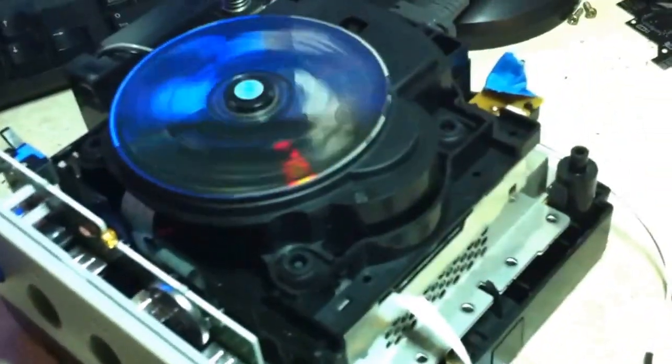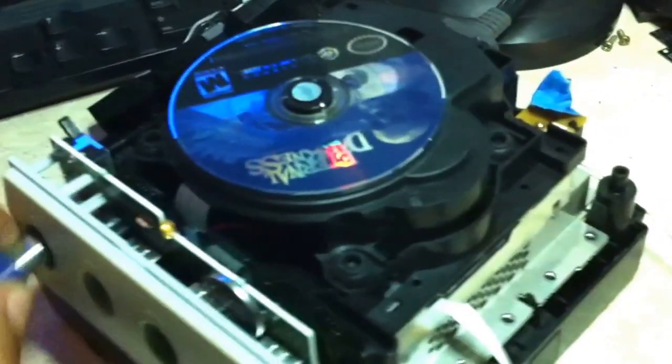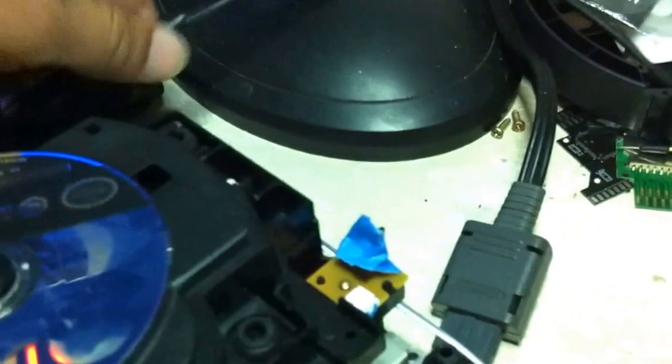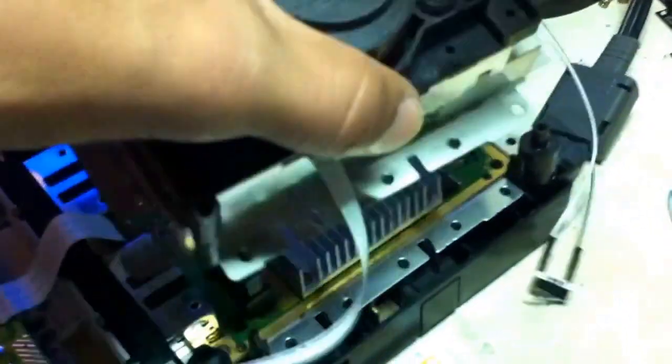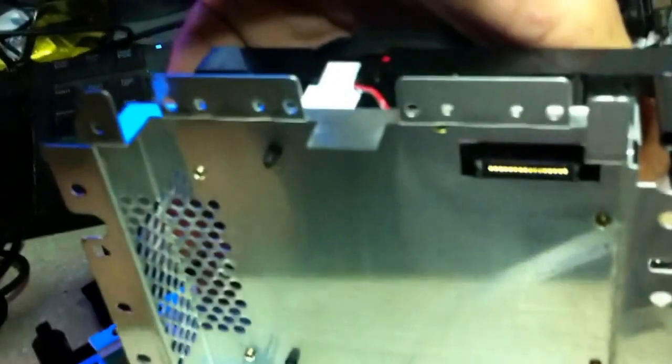The great thing about this setup is taking it apart. Take the fan off, take the front controller board off, unplug power. Remove the drive — and that's it. Right there. That's V4, completely installed. You can pull this out and put it into another GameCube, or if you want to do maintenance to your board or something else, you can do that, and then just put it right back in.